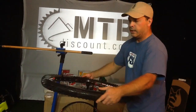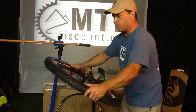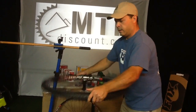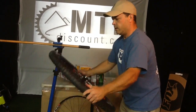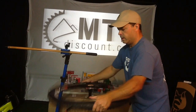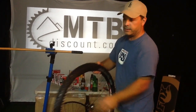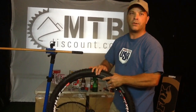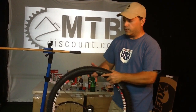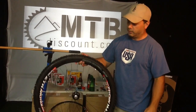Next thing you want to do is take it and disperse that sealant. Take it horizontal, give it a little shake, and kind of work your way around the tire so you're putting that sealant everywhere. You can flip it over too. Once you've done that, you're going to want to set the tire down and let it sit overnight, a day or so, to make sure you don't have any leaks. If it does leak, you're going to need to check the bead generally, and then reset it and maybe add some more sealant. It just depends on the tire. But normally the newer ones that are tubeless ready will bead up right away and you'll be good to go.